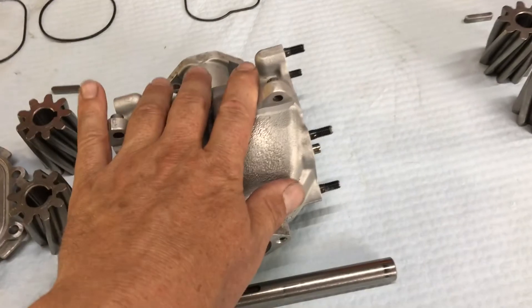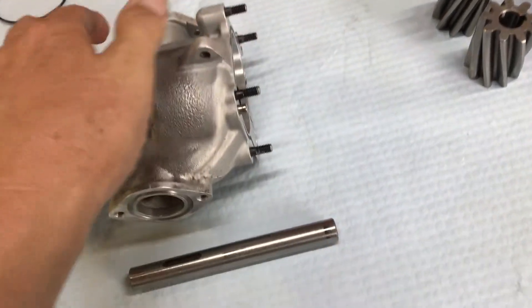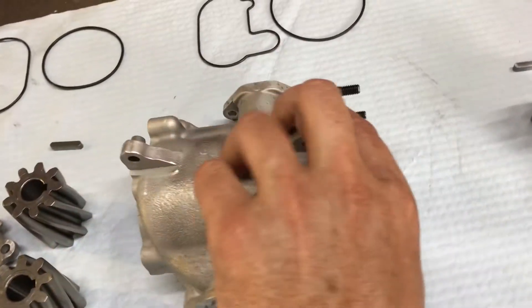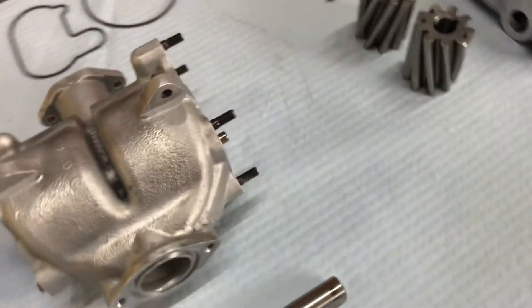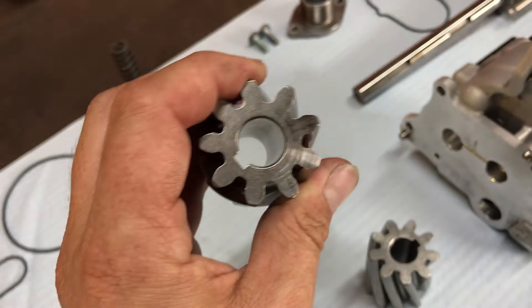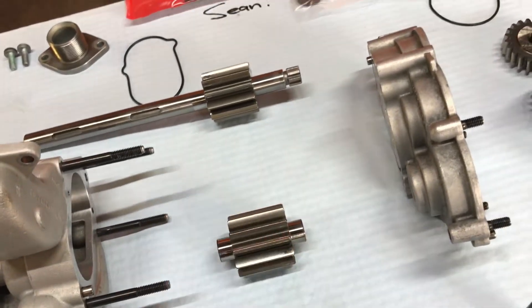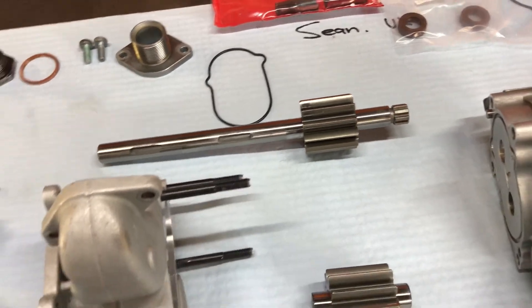Your cases should be ultrasonically cleaned if you've got that facility - if not, take it to someone. The biggest worry is damage in these walls here. This pump is actually really nice - it's a lot better inside than what it looked outside when it first arrived. It has begun starving of oil at some stage in its life, because the gears have just started to pick up on the ends. These have been isotropic polished so they're looking like new - it should be better than new. Everything's been crack tested; we Magnaflux crack test all the gears and all the shafts to make sure there's no cracks starting to propagate from the keyway slots.